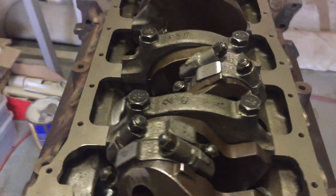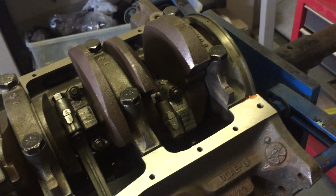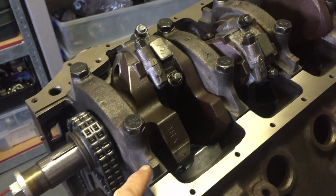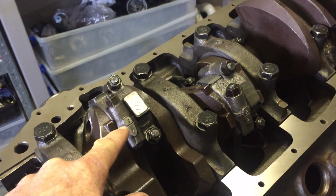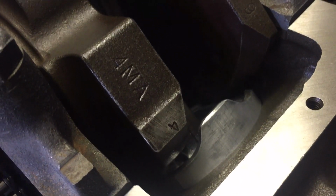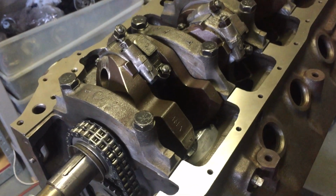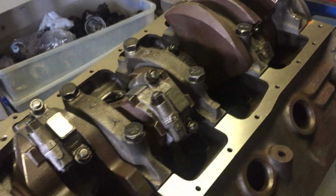And not surprising that this bottom end really looks quite boring and plain. There's nothing exciting about the phase 3 bottom end. It has just regular 2-bolt mains. It had the regular 351 Cleveland standard conrods with upgraded bolts. It had just the regular 4MA or 4MAB crank. And honestly, the phase 3 bottom end was particularly boring and does not look high performance at all. And so that's how Ford Australia did it.